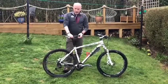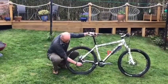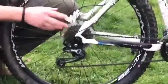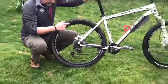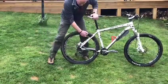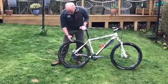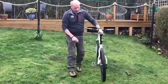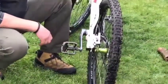Once we've done that, we're looking at the fourth part of the M, coming down this way. Checking the frame as we go, we're going to check the rear mech — make sure it's all fixed nice, firmly, and securely to the bike. Make sure your gears are in good order — no lots of missing teeth or dirt clogging it all up and stopping the gears from working. Same as the front wheel, check the rear spokes with a squeeze all the way around. Check the rim and tyre wall — make sure there's no abrasions, no bits of wire sticking out, no holes, and check you've got ample tread. Check the rear quick release is done up the same as the front, and check this brake and rotor to make sure they're all in good order.